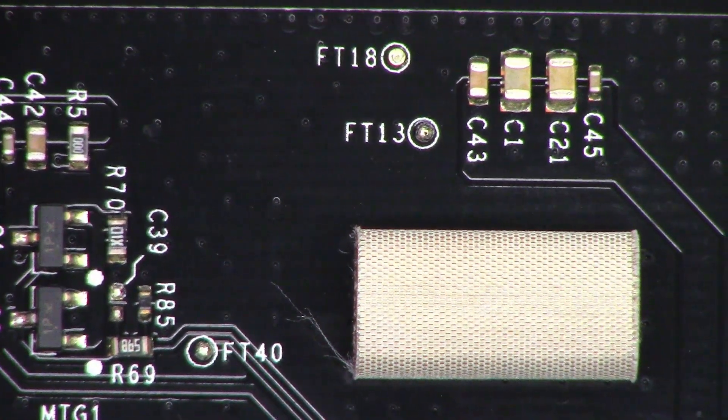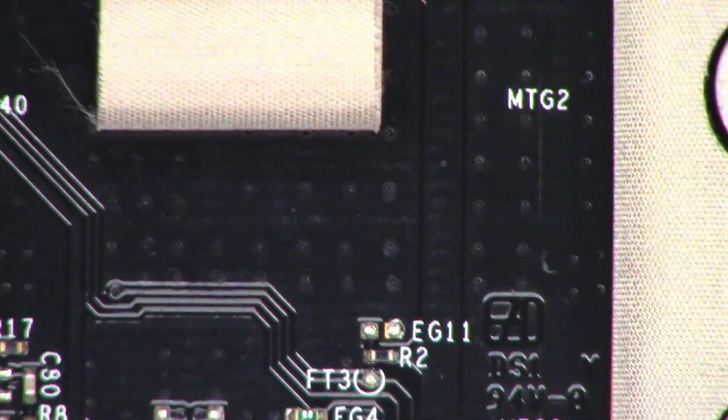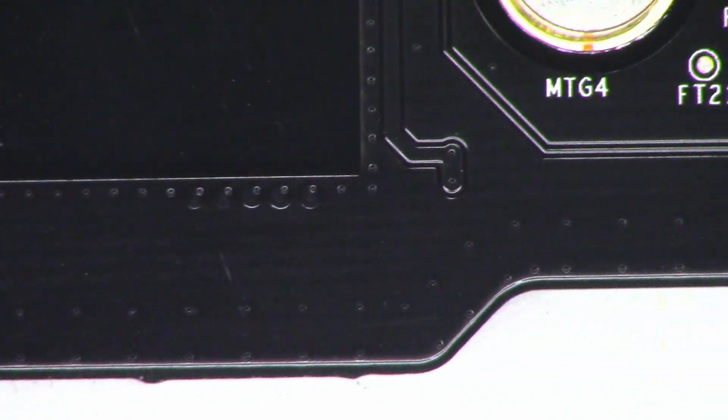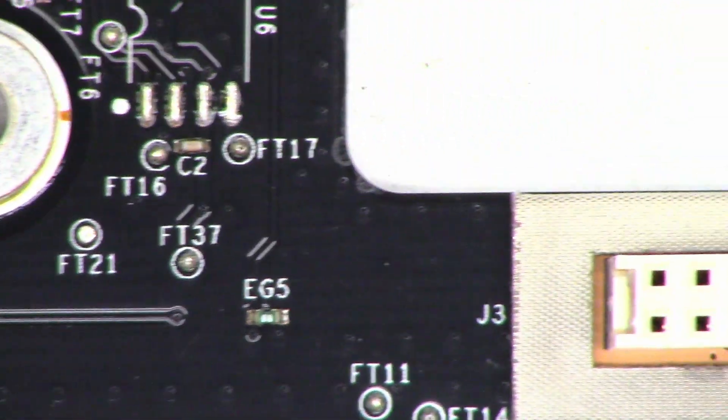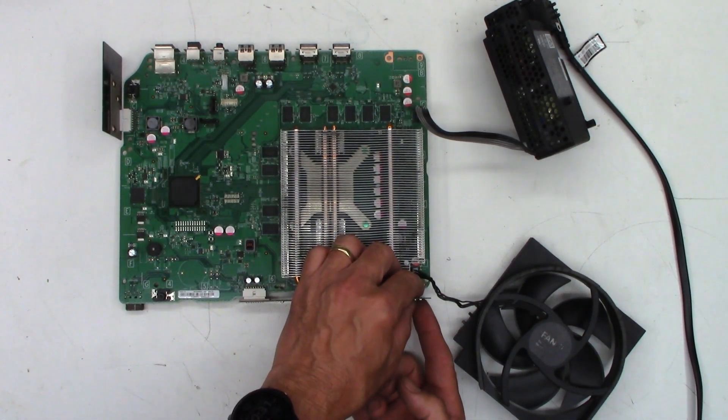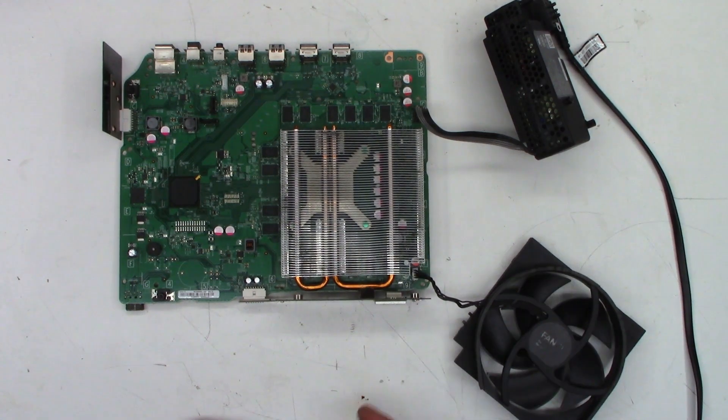So now I'm going to go ahead and plug all these boards back on the unit and give it a test fire and see if it does anything at all. I just have it loosely assembled right now. I'm going to go ahead and give it some AC power and see if anything happens at all. And the fan does bump — that's a good sign. Let's hit the power button and see if we get a light over here. I do get a light, then the light goes off. I don't have a hard drive or the DVD drive connected at this point, so I'm not sure if that's normal or not.